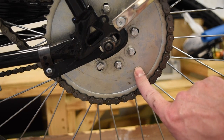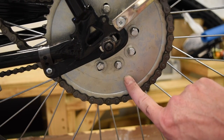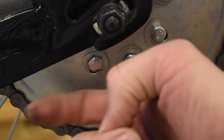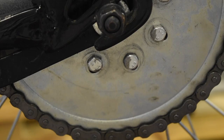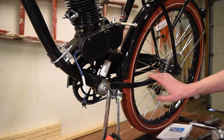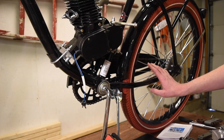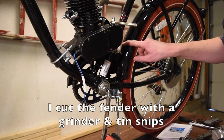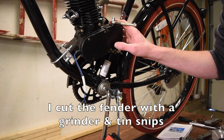After I installed the rear sprocket I realized I put it on backwards. There is a little bit of a bump here — this bump should face away from the wheel so that it gives more clearance from the tire itself. I've gone ahead and put the back wheel on. This is just temporarily; I'll probably have to take it off so I can cut a piece of this fender out.